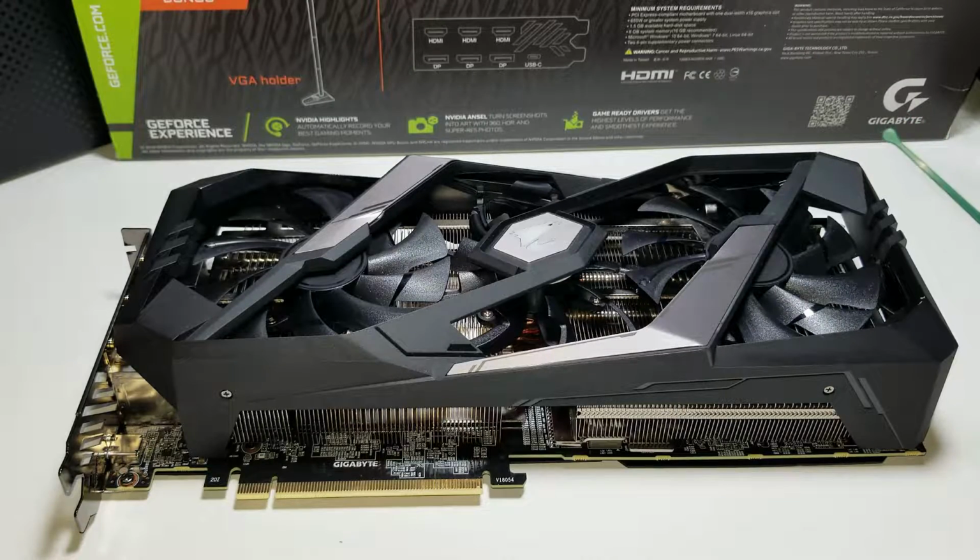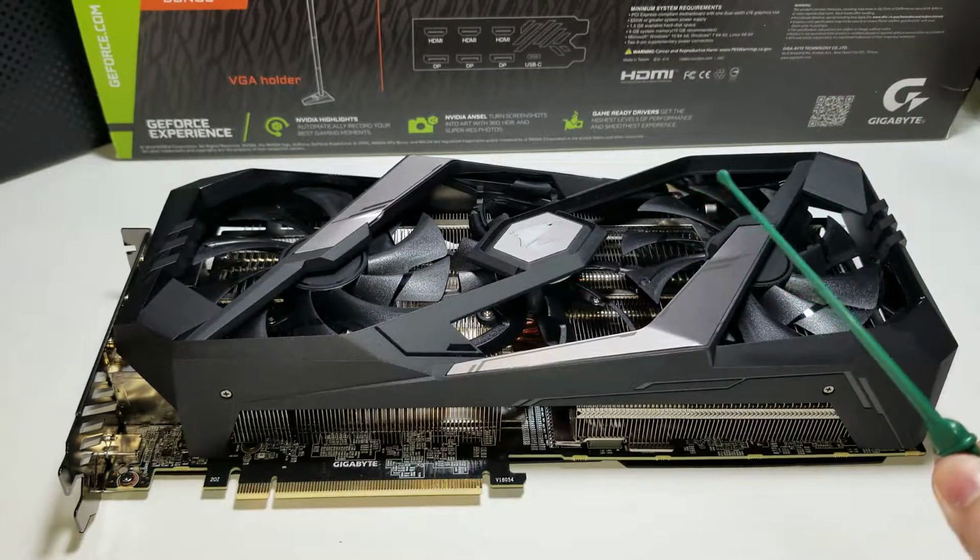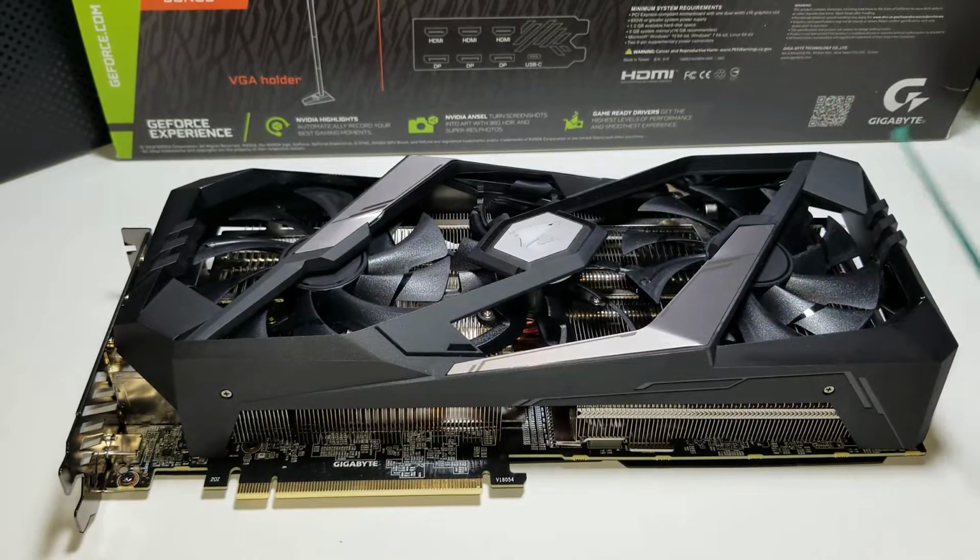And I actually sometimes saw, even with a 100% fan profile or an 80% fan profile, I tried 10 times each. And I think I saw a slower graphics card, slower performance, when I went to the plus 80 and plus 200 megahertz, which would be 8,000. So I dialed it back to 7,800, and I dialed it back down to 60 on the core. And I believe that's the sweet spot, just because I saw better improvement in FPS when I went back. So I don't know why that happened.